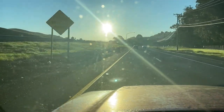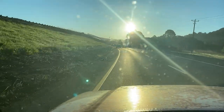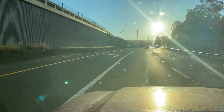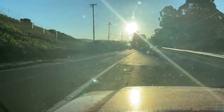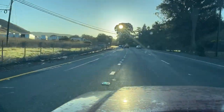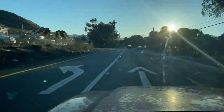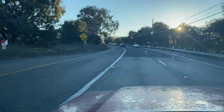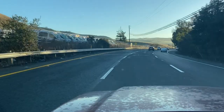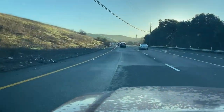The GMT 400 was a really nice truck before this. And then there's my favorite, the square bodies, which are like unobtainium these days. But yeah, for an affordable pickup truck, these are good. And this is pre VVT, so it's just pure hot rod motor. I know you can upgrade the VVT motors and cancel out the VVT cam and timing set and all that. But for just a pure fun LS, tough iron block LS, these are great. And if you can find one with an LM4, that's even better. That's the all aluminum 5.3.